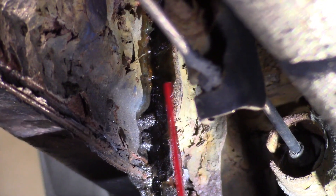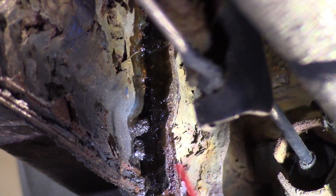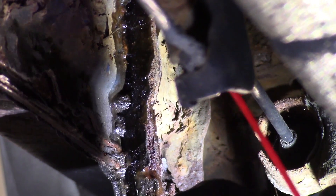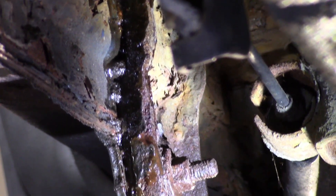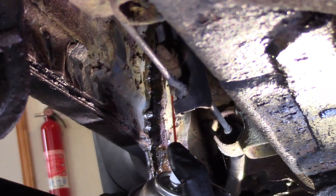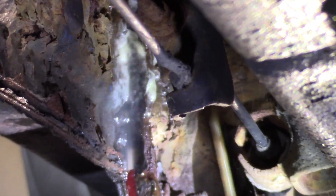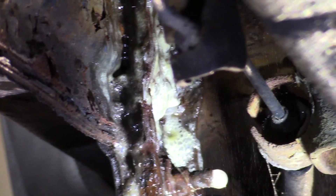It will prevent water from getting in there, because oil and water don't mix. So once I do that, I'm going to take Terminator and hit all the seams, all the tight spots, all the areas where it needs to creep in — and it will stay. And then I use the thicker Fluid Film, which is also compatible, and I will coat the whole thing with Fluid Film. That locks it in there, because this is more of a sticker — it's got the lanolin, the wax component. It's thick and it sticks and it stays.